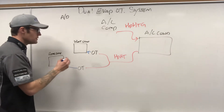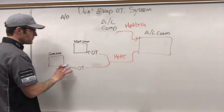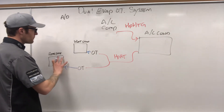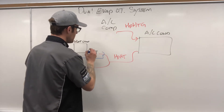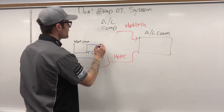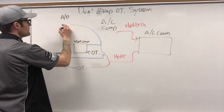What I'm going to do is tie these two lines together. Usually you'll be following the rear lines along the frame, and they're going to pop in pretty far back on the cab. When the return comes out, it's going to jump over, and these lines are going to marry again and head to the accumulator dryer.